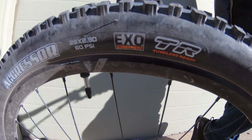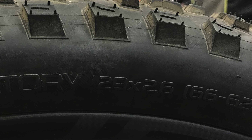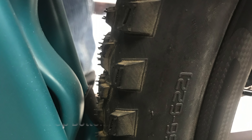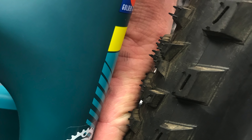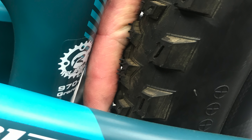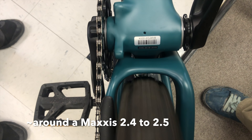In this ride we had a 2.3 Maxxis Aggressor, but word on the street is that 2.4 is the maximum rear tire size for the 130. I tested an alternative rear tire with Ryan, the owner of Ruby Canyon — we slapped on a 2.6 Specialized Purgatory and didn't have any problems. Granted, the Purgatory definitely runs on the smaller end of the 2.6 sizing. Just keep in mind that sizing is sort of different across the board, so take this with a grain of salt.